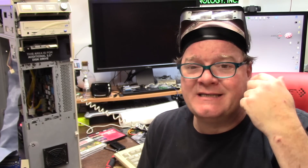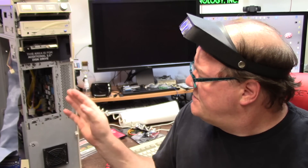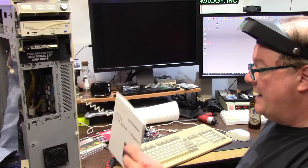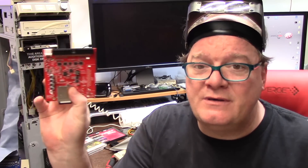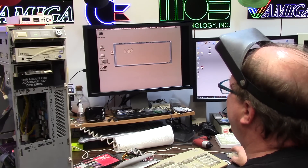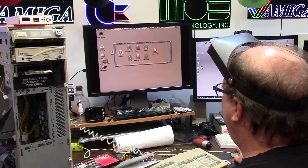I'm going to read the online documentation in further detail because when you get something new you just want to roll with it. So I've got to read through the FAQs and see what's in the archive. But this has been my quick review — a basic speed comparison. I tripled my speed on this card over the stock Amiga 3000's SCSI.device. I did have to change the ROM from the factory 4091 ROM to the open one it came with, and that woke her up like night and day — from one or two megs to six megs per second. The Zulu SCSI is fast, fast, fast.